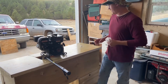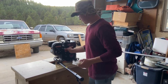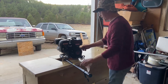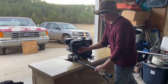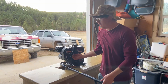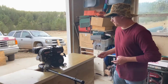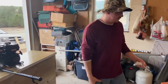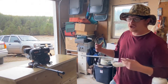I've got to fill back up with oil now for the third time. Flip it back on and turn the throttle up a little bit. I shouldn't need to turn on the choke, but I might have to. I'm going to bring it up to about a third throttle — that's a little less than half throttle. We'll run it like that for about 10 minutes for the third break-in cycle, then I'll shut her down and change the oil again.